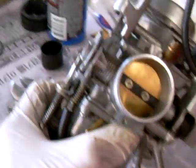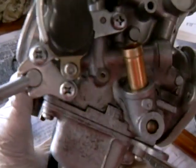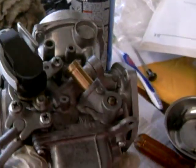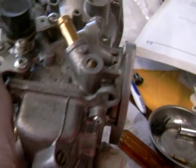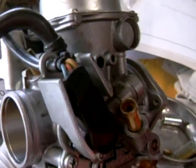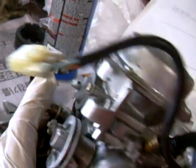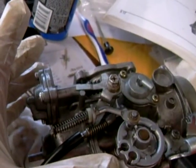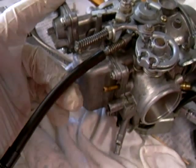The good way to clean these carburetors, I've heard, is getting it sonic cleaned — there are places that do cleaning with ultrasound — but they're going to get dirty again. So just regular gasoline and carburetor cleaner with compressed air is the way to go. This project here is going to save you roughly $300, and you get to have fun with it.